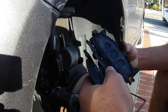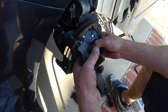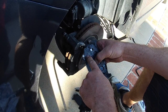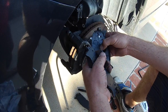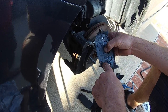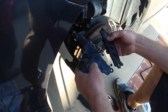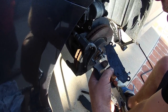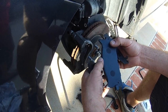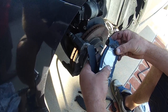Now this though — the factory does send this black stuff. I don't know exactly what the chemical is, like a grease or whatever, but they send little packets of it in their brake pad boxes. And I always reapply that if I'm using factory pads. But these aftermarket pads — the shim's already there. Look, these ones are better. See, this is a two-part shim.